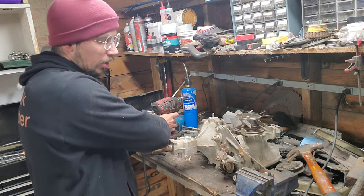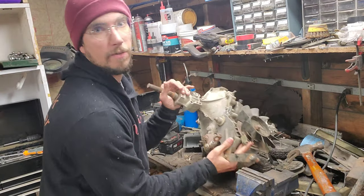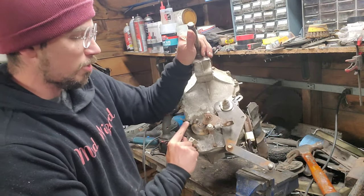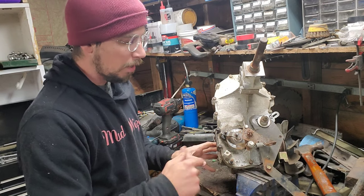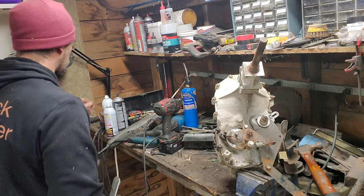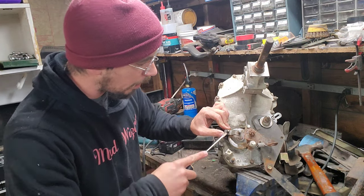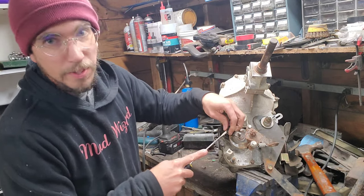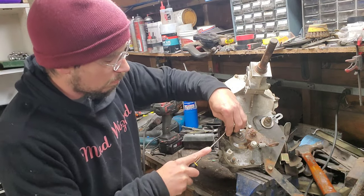If you're going to break this case open first, get this diversion valve piece out — there's a diversion valve right there. We're actually going to be eliminating that for the dragster anyway. You take it out, and once the transmission is fully disassembled you tap that out, put a bolt in there, cut it flush, and call it good. That's just a flathead screwdriver working your way around it. These are theoretically reusable but I don't trust them — I replace them. There we go.